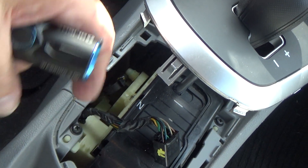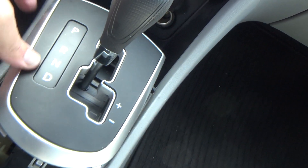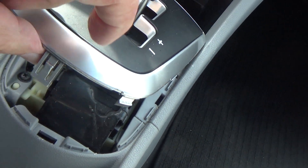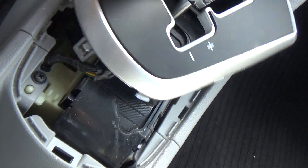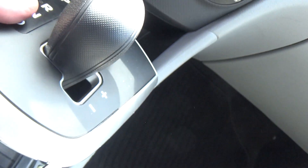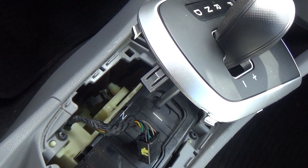I've got some generic bushings and I've spent less than five minutes on the car. The shifter bezel just snaps off — I used a screwdriver, got underneath the corner, snapped the first corner up, and the rest popped up. There's a connector right here that hooks on, and you can wedge it out of the way to get enough room to work.